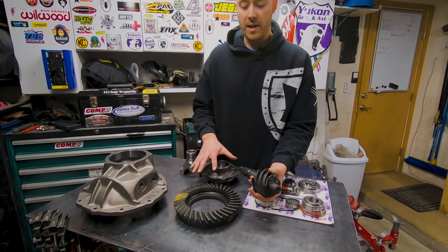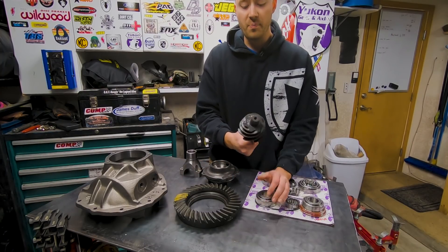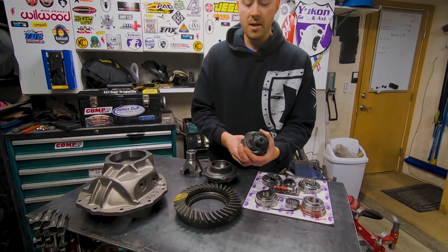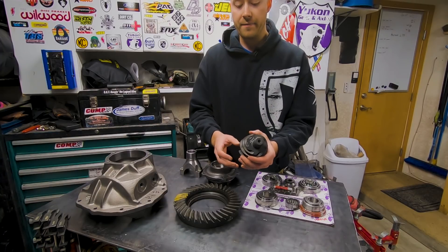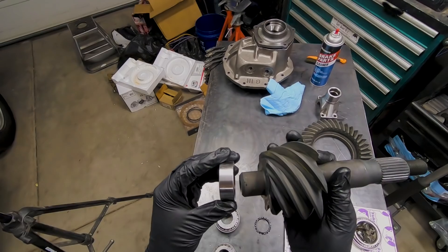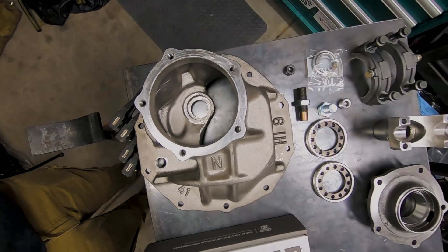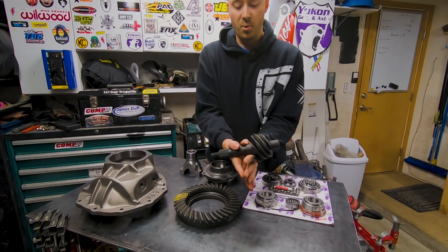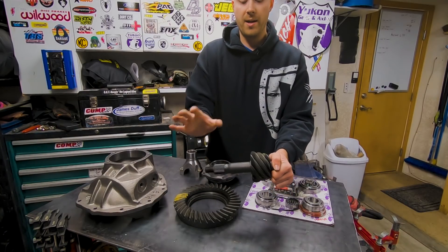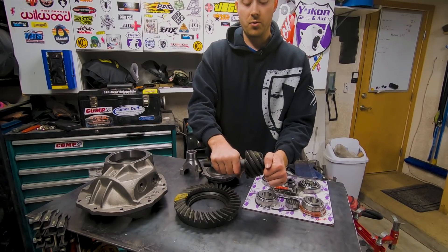The first part of putting together a Ford 9-inch from scratch is assembling the pinion cartridge. The pinion of the 9-inch is kind of unique. Dana axles, the Ford 8.8, and some other axles don't have a third pinion bearing. You'll notice the snout on the tip of the pinion — a little bearing goes in there and gets installed in the third member itself. So not only do you get two pinion bearings supporting the aft end, you get one on the front. That way you're secured at both ends to really control pinion deflection. It is a very strong design.